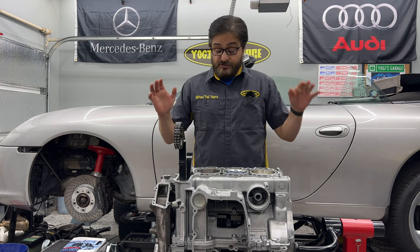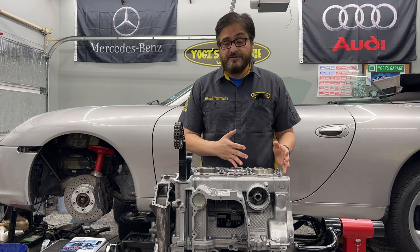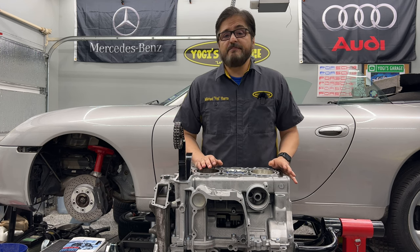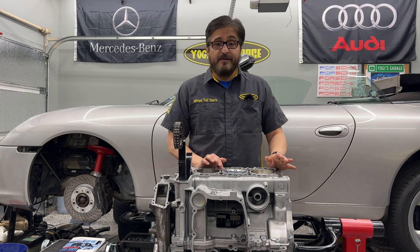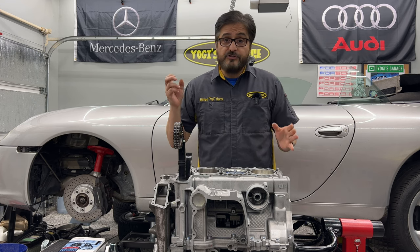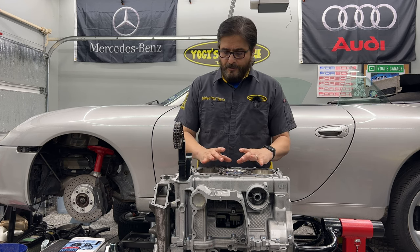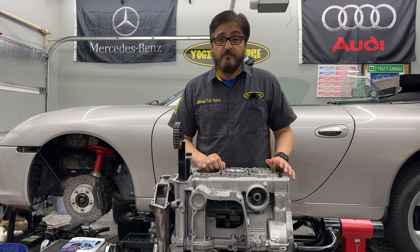That was really stressful. So I have taken care of cylinder six, which is by far the hardest piston to take care of, and they get progressively easier. However, I'm not going to let my guard down and I'm just going to keep chugging away. I'm not going to show you the rest of it because there were a lot of gaps between what I was doing. I had to take a step back, take a breather, figure it out, and get comfortable with how things are supposed to feel - how the alignment dowel fits into the hole, how the wire lock tool fits in there. It takes a little practice, and by piston number four I should be extremely confident.